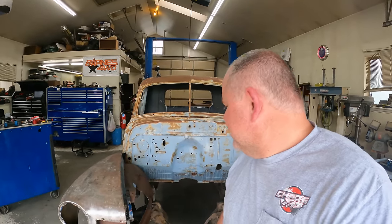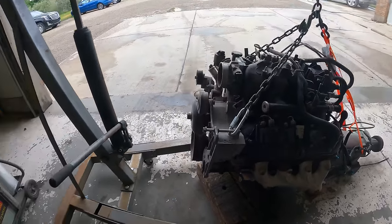Now that we have the radiator support pretty well done, it's time to see how this motor's going to fit. This is the part I've been a little bit concerned about — trying to get the motor in a place where it looks good inside the engine compartment. The problem with most of these swaps is the engine sits so far down and far back that they look terrible and you about have to stand on your head to work on them. I'm hoping we can get the engine up in a good spot in relation to the firewall to make it look like it's supposed to. We got the adapters on the side of the block, got a two-wheel-drive trans on here, so we're going to play and see how it all looks.